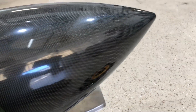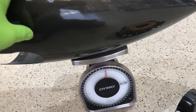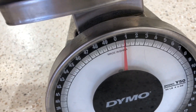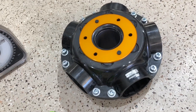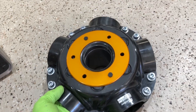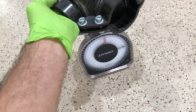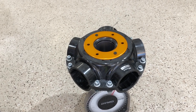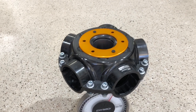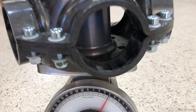The spinners are first class — super thin and lightweight. The weight of this 14-inch spinner is less than a pound, and that's for a five-bladed propeller. The five-bladed propeller hub will also become a constant speed variable pitch propeller by Viking for the Viking gearbox, with a really simple shaft through and no mechanical components out in the propeller other than the carrier. It only weighs four pounds. This is an empty hub.